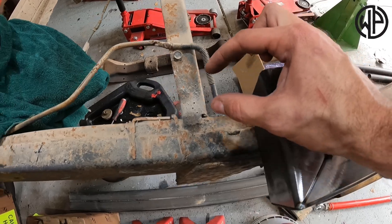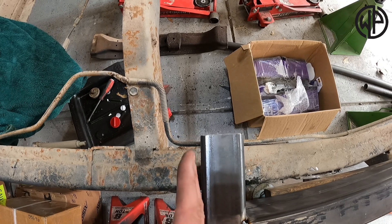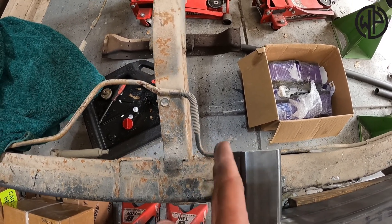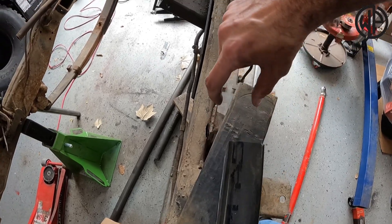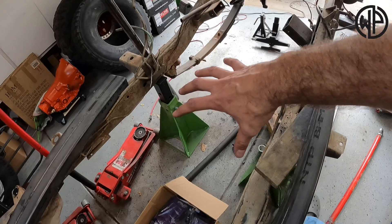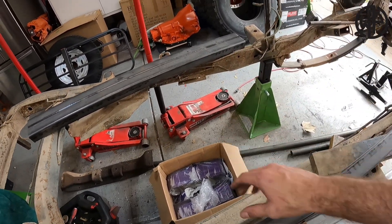I'm going to notch this piece of tubing to basically go straight back, so that's going to work really nicely. Look how much wider we are making the frame. We're making it a bunch wider, but if we start to curve it now in, it's going to give us plenty of room back here for our exhaust, transmission, transfer case. We're doing a driver drop, then a muffler over here. I'll just copy the other side — you've already seen me do one side, so YouTube magic, here we go.